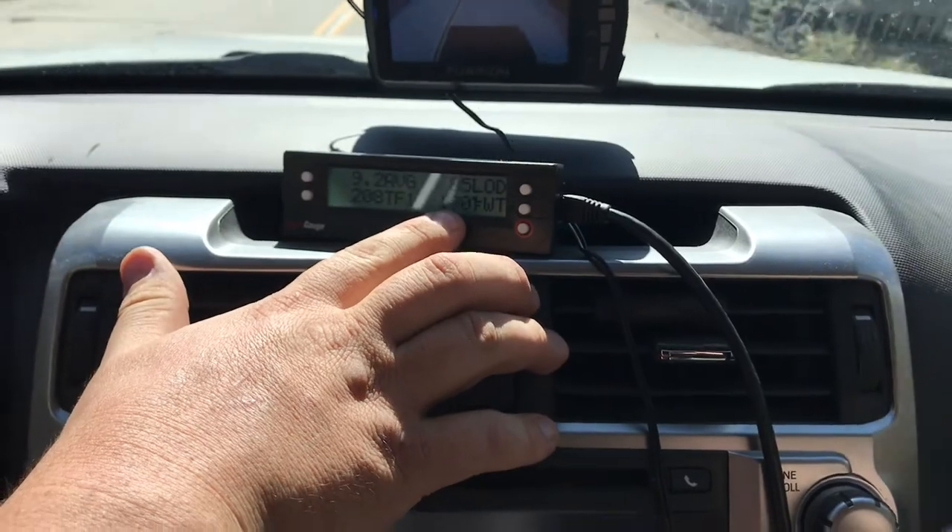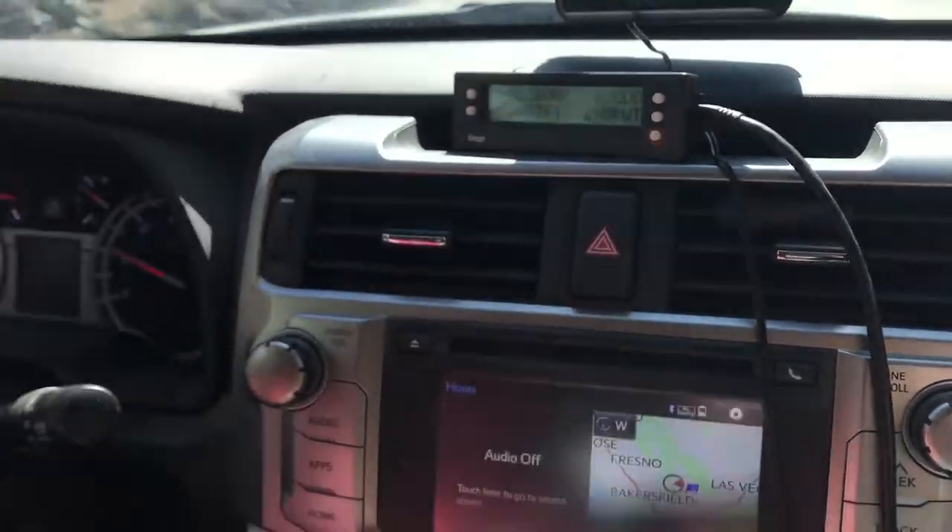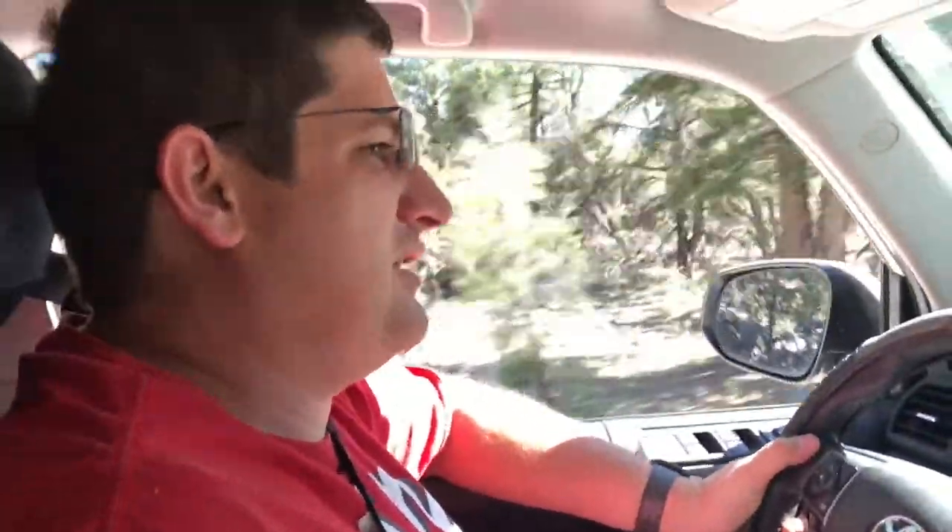And then this is also the coolant temperature of the actual engine. Whenever we're actually towing, you always switch over to S mode — I don't use D mode. You don't want to go past fourth gear, because if you do, it unlocks a part of the transmission which is technically like an overdrive. That makes the transmission work too hard, brings the temperature up too high, and stresses it out. So the Toyota 4Runner does a pretty good job with towing capacities like this as long as you don't run too high a gear ratio. In terrain like this — second, third gear — I can do just fine. Just have to make sure it's okay to run RPMs up higher so you don't lug the engine, and it also doesn't tax the transmission as hard.